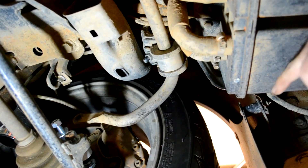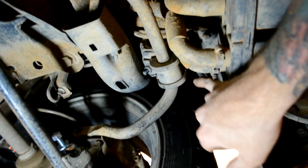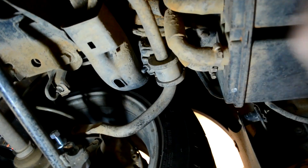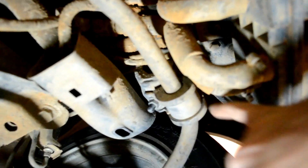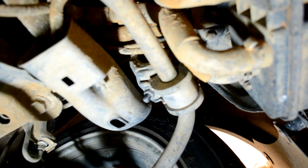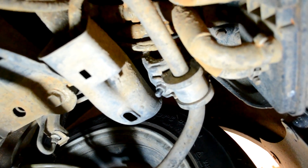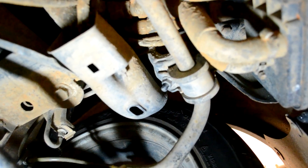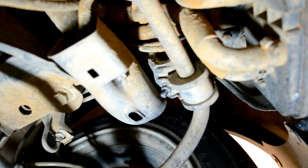We're going to start with the rear, on the passenger side you've got one nut here and one bolt that's actually tucked away back here. It's best to take this box off — there's one bolt right up here and two towards the rear. Just take it off and drop it down a little bit and you'll have plenty of room for that bolt. On the other side it's the same thing, just one nut and one bolt, and luckily there's nothing in front of it. Take that off and the sway bar will come right down — you've just got to move it over your exhaust.